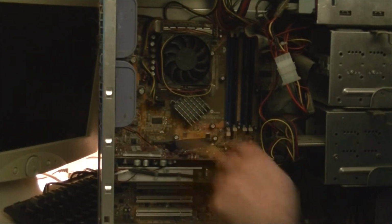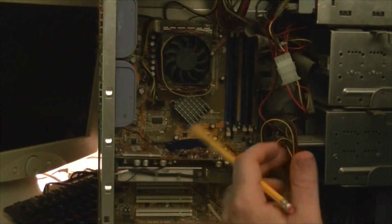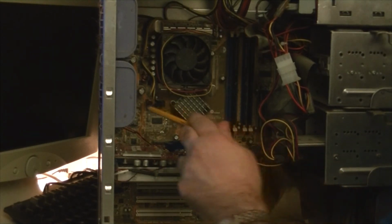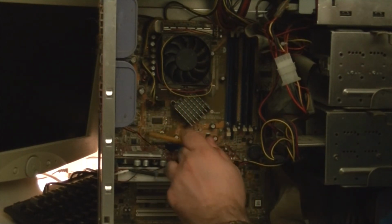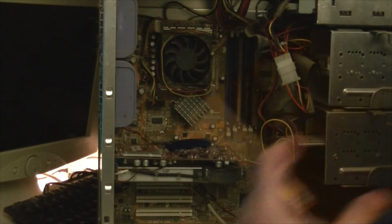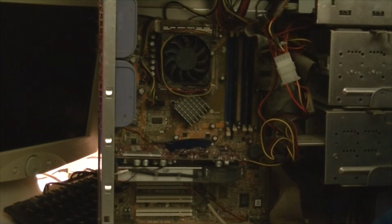The sound card right here is a SoundMax AC97, which you don't really see. And when you plug it into speakers or headphones, if you crank up the volume midway, you're going to start hearing distortion, like this thing has bad shielding on the onboard sound card. So what I am believing could happen is it could be making so much noise that the system just pretty much locks up, because it is so noisy that as soon as this starts to be used, the entire thing goes bonkers.